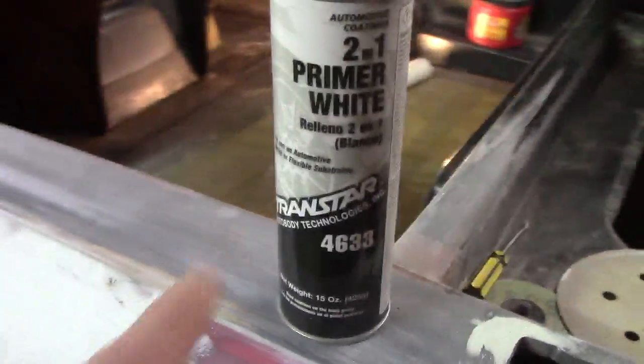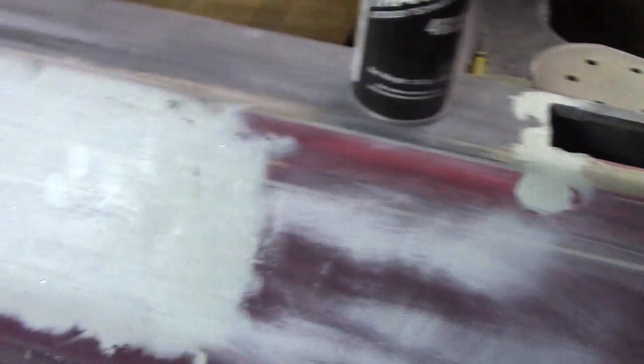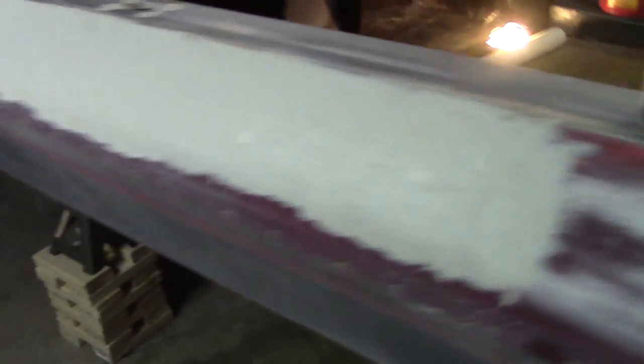Before I come in with my spray gun and primer. Actually this is pretty good stuff and it sands well. I'm going to be using the same brand — Transtar urethane primer — but I'll get a gallon can of it. The spot primer is just so I can squirt a little on it, do all my filling and sanding, and then when I give the whole thing a coat of good primer I won't have too much body work to do. Should be ready to wet sand and paint — that's the plan.